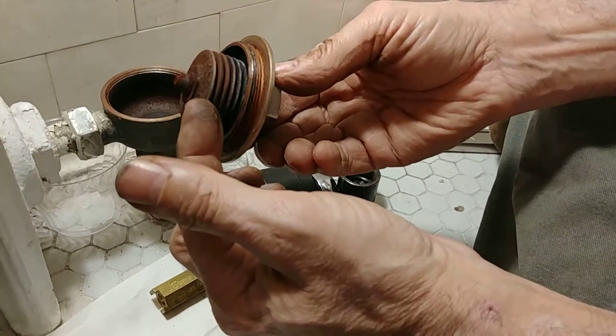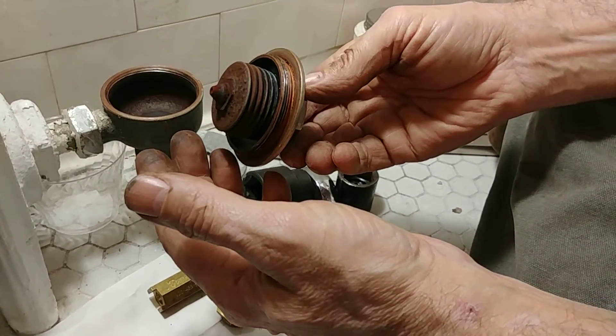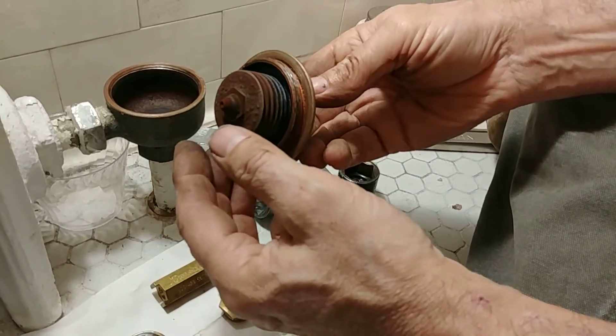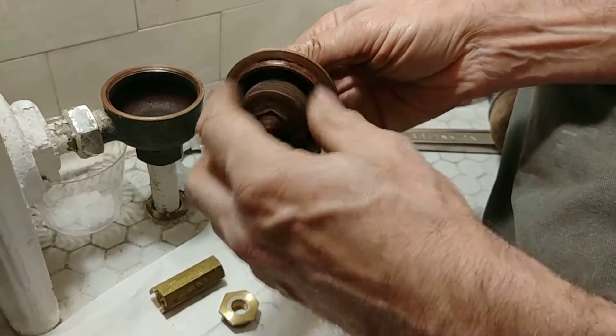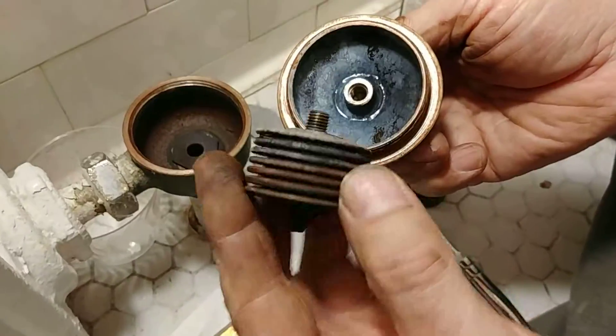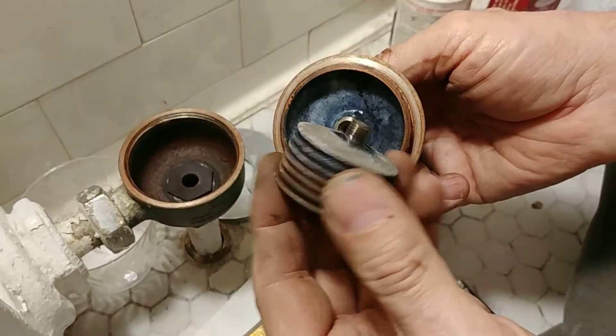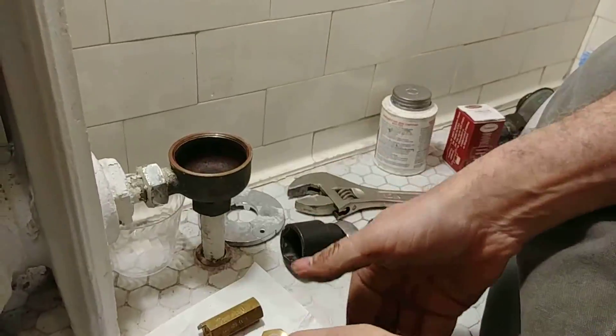This element failed in the closed position, so they made this failure easy to diagnose — the radiator simply didn't heat. The element is just threaded in the cap and we just have to remove it. It comes out fairly easily. Sometimes you might need a pair of channel locks to take it out, but this is then scrapped.